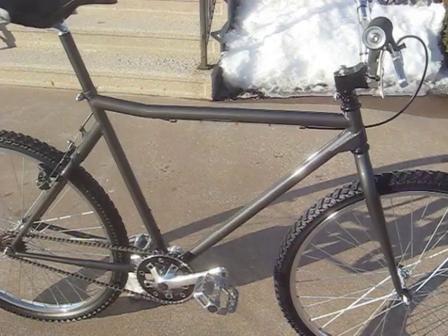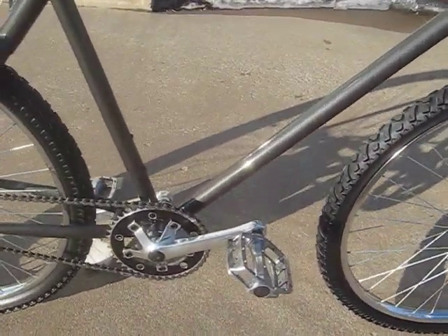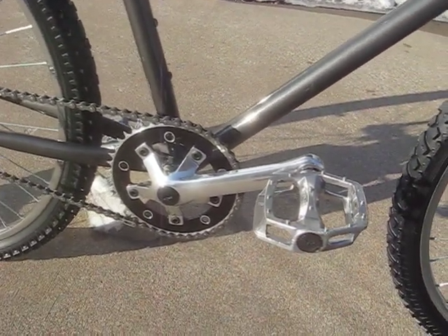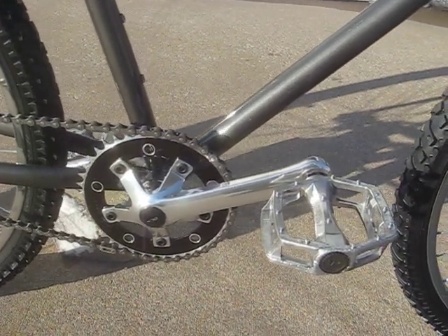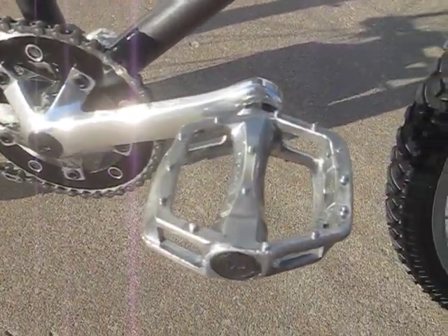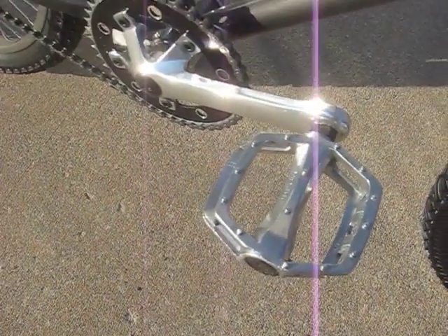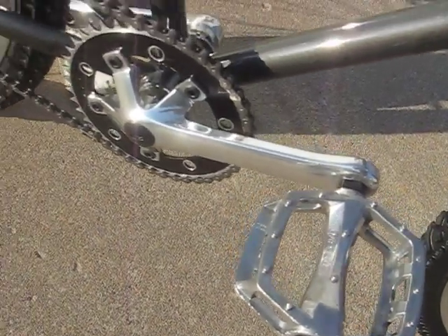As I had stated before, I'm just running that rear brake. I had mentioned that I might do something with the pedals. After going that far and seeing that polished set of crank arms on there, I couldn't just leave those pedals alone. So now I'm way over-invested in time on this bike. I stripped the pedals, did a light bit of polishing on the bodies, got every speck of black paint off, and repacked the bearings in them.